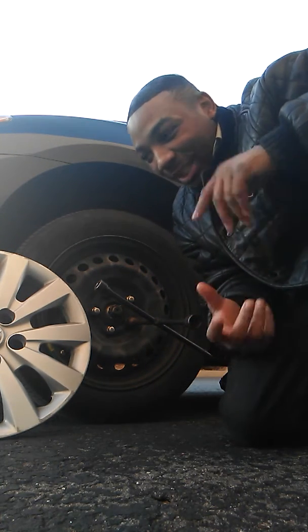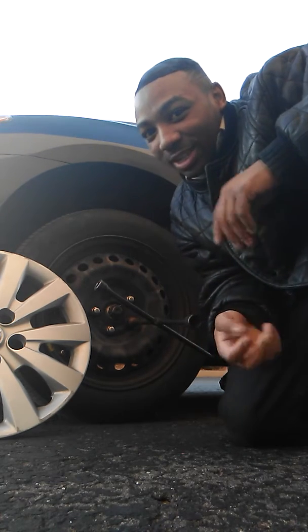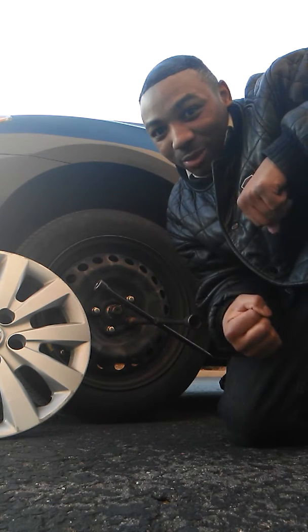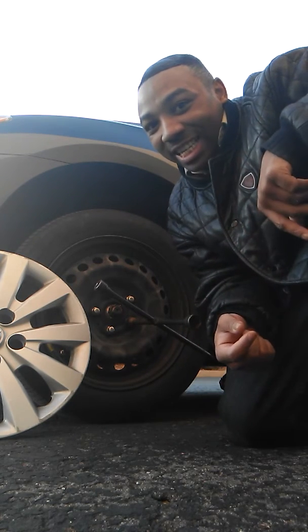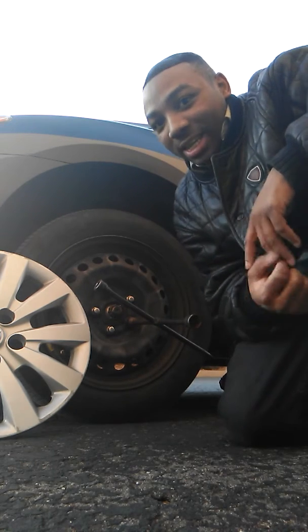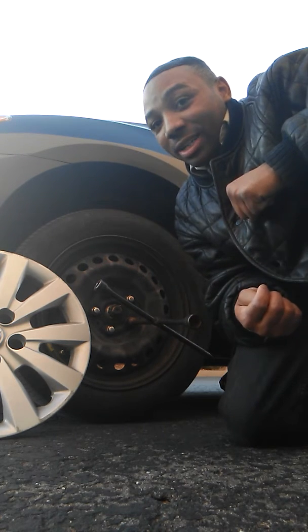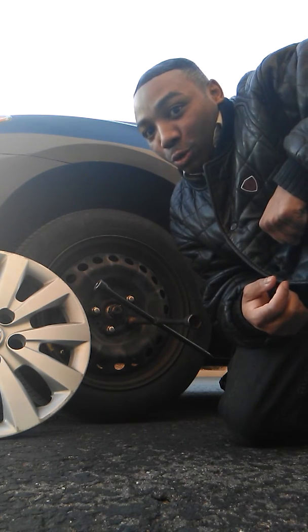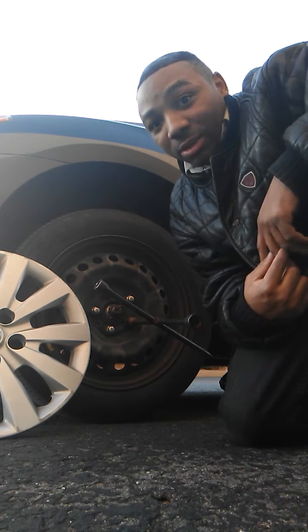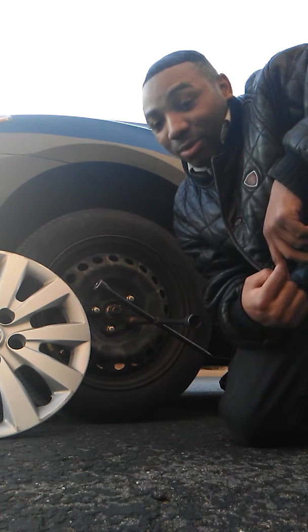So I heard a little bit of noise when I stop on the brakes. When it does that, that means the brakes are starting to get low. It's not scraping yet. The scraping would be the next stage, and then the last stage would be when the pad wears out all the way to where it's grinding into the rotor. When you hear that, it means it's grinding into the rotor and it'll mess up your rotor. Then you'll have to replace brake pads and rotors.